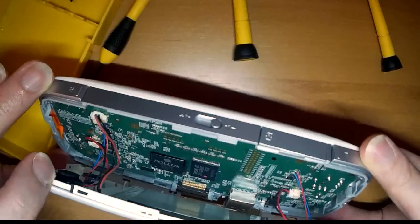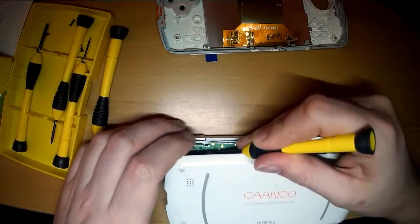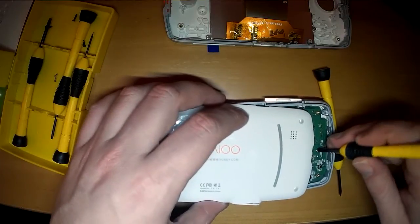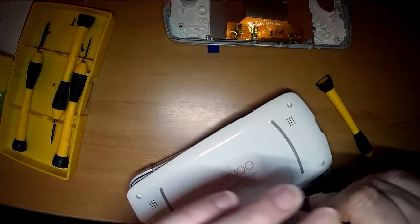Once you look inside you'll see there's a lot that's soldered together and they don't always unclip — some are soldered directly to the board. I personally take the battery off before I start so you can't short anything out. Then to get to the screen you have to take off these four tiny little screws that are bolting the board into position so it remains flush to the front of the unit.